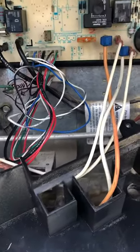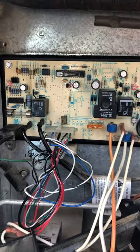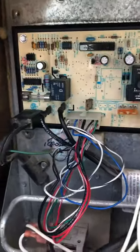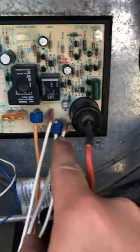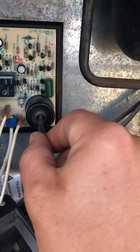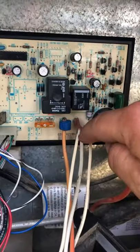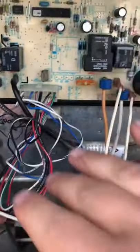That exposes all of this. Then with the refrigerator off, you disconnect the following from the board: the 12-volt DC — this. The AC power cord — this. The gas valve solenoid coils — these two things, or you could pull them off the board. And then these two wires. And then this. I pulled these two just for safe measure. Take a picture so you know where they go — maybe make a mark, because these two look the same. What I did is unplug this one up high and this one down low so that there was no confusion.